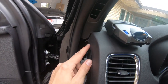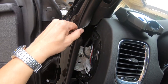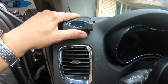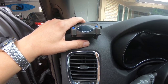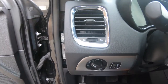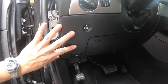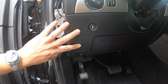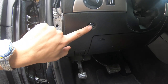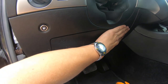This is where we ended up with the mount. What I did is I popped this piece off right here — it just goes behind this trim here. I routed the wires down. The reason we chose this location is I'm going to use some Velcro to put it onto the dash, that way it's not down here. Putting it right here was my first option, but it started blocking the hood release. Getting it too high up, it blocked the gas tank release. This real estate right here is no good because that's your airbag.